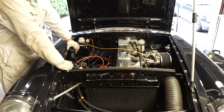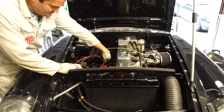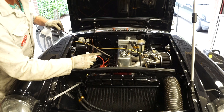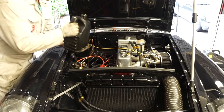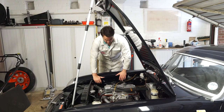The car's sat for a few minutes so let's check the oil level again. At the moment that's reading spot on the maximum. I'm going to put just a tiny bit more in — I like to run this engine just a millimetre or two over the top — but you certainly don't want to overfill it. Just a tiny splash more to top that up, and with your cap back on that completes our procedure.